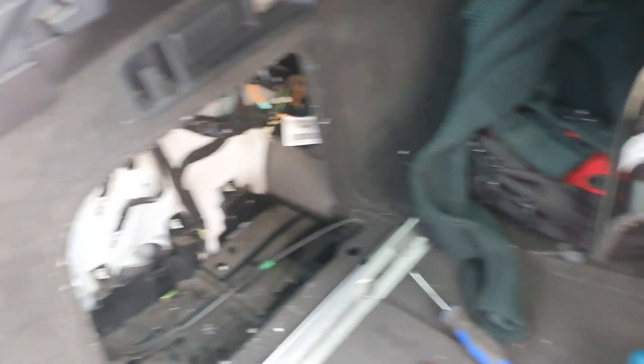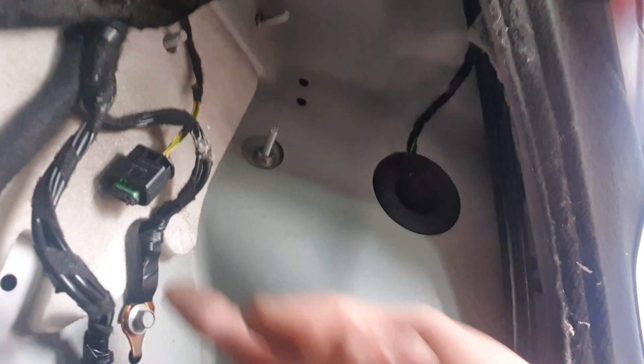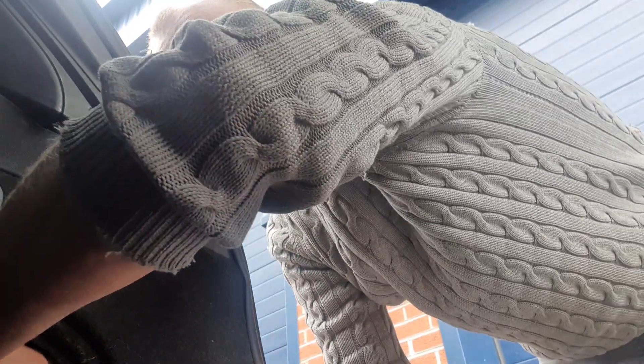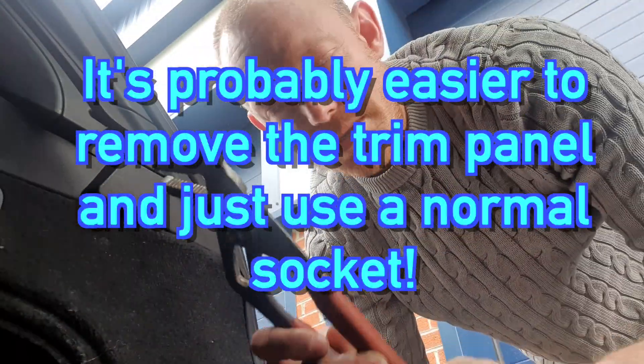On the inside of the car, remove the cubby hole — it just kind of lifts up and pulls out. Inside the cubby hole you see a nut that needs to come out. And I had a horrible feeling there'd be another awkward one in there. I took off the easy one and the tail light doesn't come out, so yes we've got to take them both out somehow. I've loosened it — I took a normal 10mm socket, put it on the ridiculously long thread, and used grips to loosen it, and now I'm undoing it with my fingers.